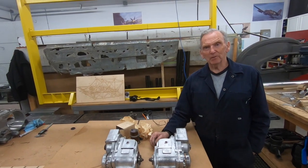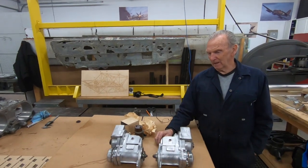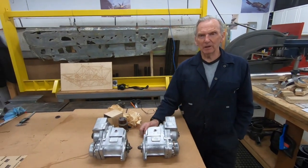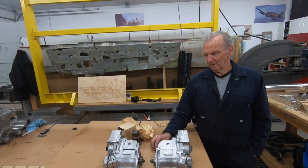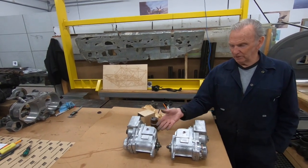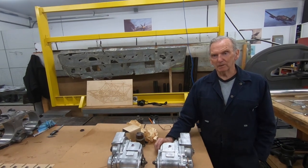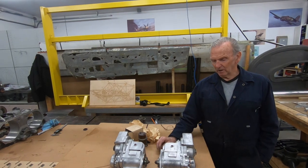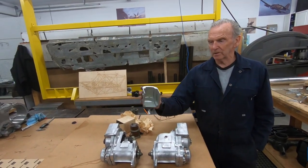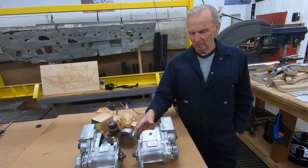It's just one step closer in the whole program and we're making headway. We have four magnetos total — it took four magnetos to make two good ones. Two of the armatures you couldn't do anything with; they were just a solid glob of steel, probably underwater at one point. But we managed to salvage them and they're putting out good voltage — you could show 200 on the meter if you spun it hard enough, and that's with no contact points — not yet collapsing the secondary field to generate high voltage. I varnished all the inside of the cases and covers so there are no sparks jumping out to the aluminum casing. One coil came from Australia and the original was still good.